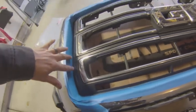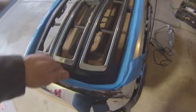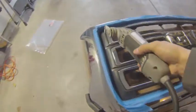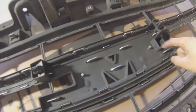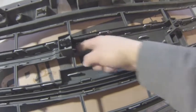We got the grill masked off — not pretty, but it'll work. One lesson learned: take the tape and push the non-sticky side into the corner so it gets wedged right in and you can start pushing it into place. The only intent of the masking tape is to make sure you're not nicking the chrome. Next we'll use a Roto-Zip multi-max tool to cut out the black insert portion. While we've got it here — in case you're wondering how the emblem comes off — it's seven tabs and two screws.